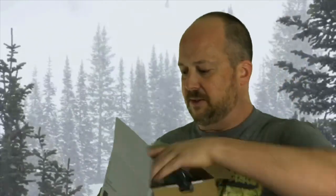So when you take it out of the box, throw the bag to the side. Okay, on the bottom there's a switch here. We're going to find out what this switch is for. I'm thinking that because it's got the tilt, it'll actually cut your space heater off if it tilts. It also says keep this at least 4 inches away from the wall and keep it away from curtains so that the curtain doesn't get sucked up in it. It also says that this can be hot. This does use infrared heat, so it says.